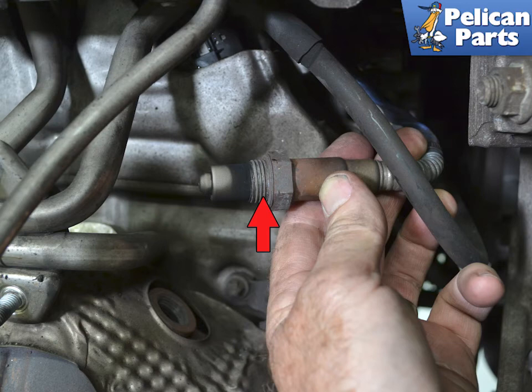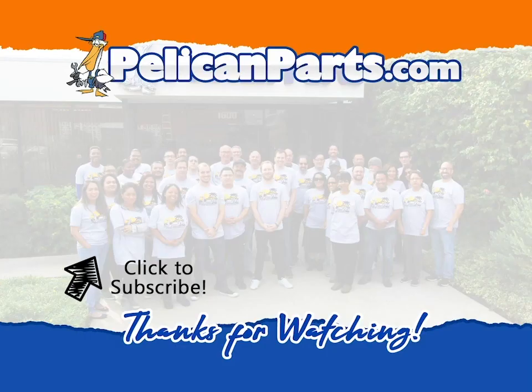When installing the new sensor, pre-twist the cable that many turns so the cable will not bind during installation. There will be a small amount of anti-seize on the threads of the new sensor (red arrow showing the area) — do not get this onto the tip of the sensor. Installation is the reverse of removal. Torque the sensors to 50 Newton meters or 37 foot-pounds.